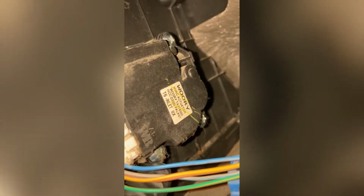So that's our one screw there, second screw there, and third screw right down the bottom here. So just take you through that. So we'll unclip this. There's a little clip in there, the wiring loom, the wiring harness. We pop that out, disconnect that out the way, and now we commence taking off the fresh air servo damper motor.